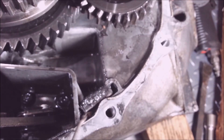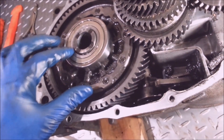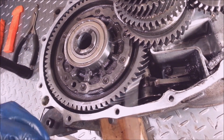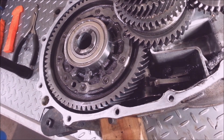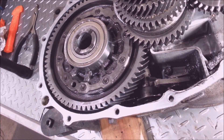I got some plastic bits here and there — chunks of plastic. There was some stuck in my differential bearing, some here and there. It's probably because of the cage for the input shaft bearing. I'm going to take the rest of this out. I'm really pleased with the way this looks and I like the way it shifts, so I'm not going to mess with it.